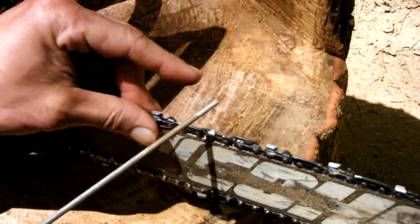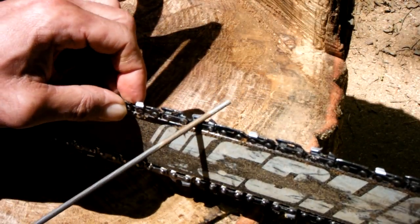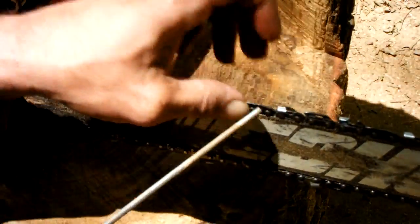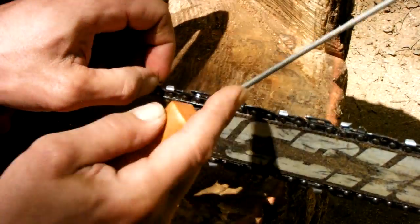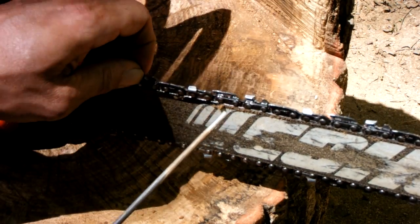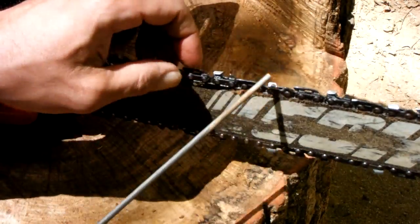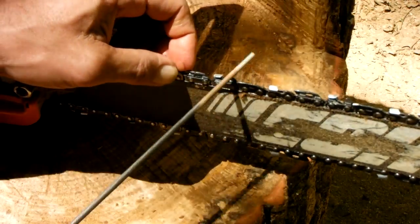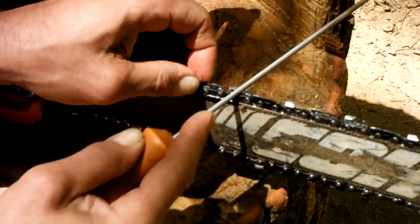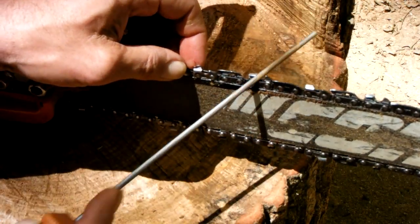And I usually just give it a couple, two to three, rasps, and when you get a feel for it, it'll go really smooth, and you'll know you're taking off material. And I just keep going, because after you cut it, you can see where you cut it, and you'll know when one comes around that you didn't cut. It's like, okay, I didn't hit that one, and you just keep going. And this is how I do it. To be honest, what I used to do is mark the one I started on, but then I realized I can see the ones I didn't cut.